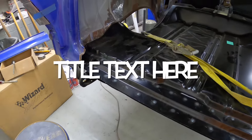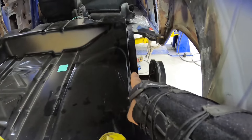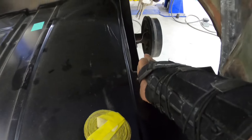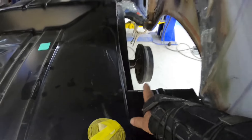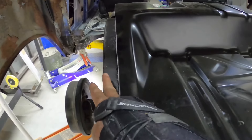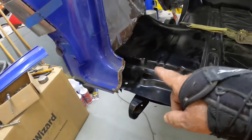Another look at the floor and our cutouts for the tub. Don't forget we're going to add an inch and a half back on because we want that original flange - that's how it's sitting at the moment. Cut back here, we have to make another flange from here to the tub. That's going to be the same - I'm going to have to make that. Same on this side - add that inch and a half back over, and then the flange comes up and around. It's got a little bit of a high spot up here, goes uphill then straight down and attaches to the tub.